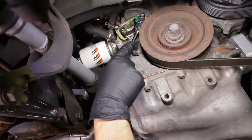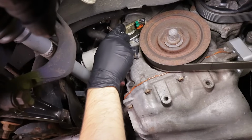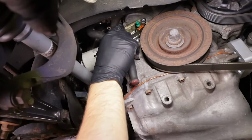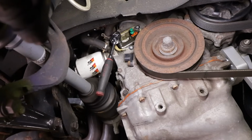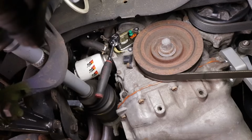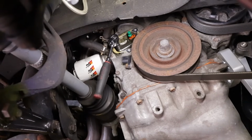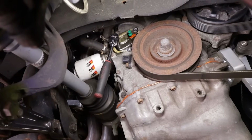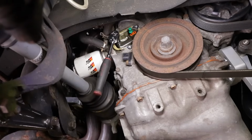Next up here, we've got to remove the tensioner, right, Rui? Yep. And normally we put a little thumbtack, which comes on a stock tensioner already, so I keep a bunch of them all the time. Before you remove the tensioner fully, you should put that in, or else when you go to pull it out, it will unlock and put too much tension, and then it's a pain in the butt to take it out. Yeah, I believe it.